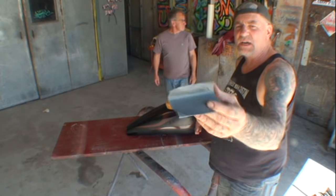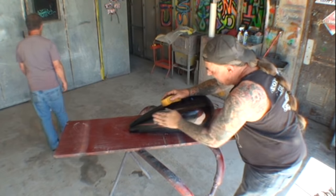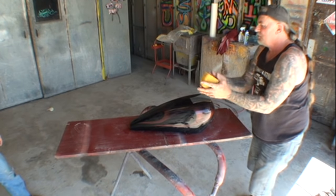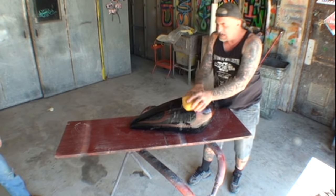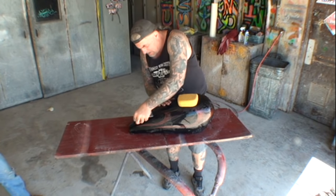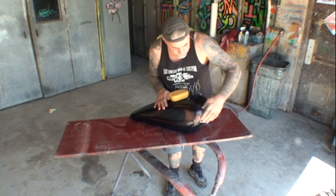The next thing we want to do — we want to go ahead and get a piece of 1500 wet dry. I'm going to take my sponge and go ahead and just sand this down. By sanding this down, it's going to remove the residue and also take the paint lines off of our ghost flames. When you're sanding this, do not use anything coarser than 1500. 1500 is the coarsest you want to go because you don't want to burn through your flame job. This would also be a good time if you got any overspray — if you missed a spot and got some pearl on — take your 1500 and using your thumb, go ahead and feather that out nice and easy.